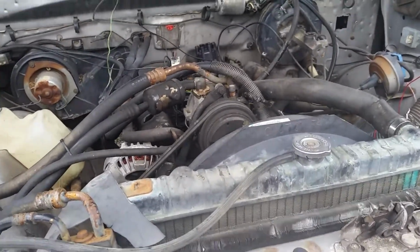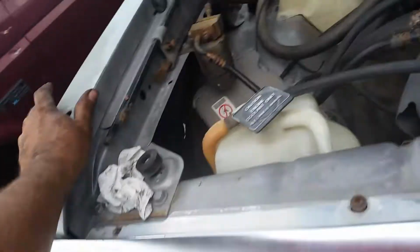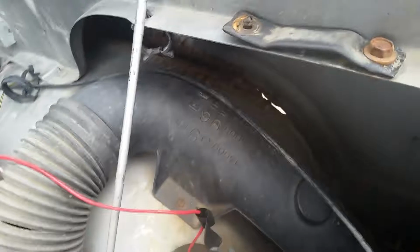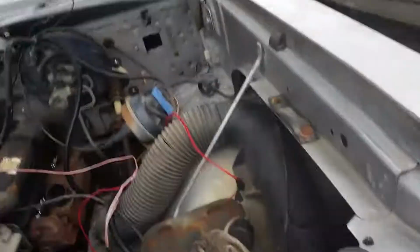This was the fancy truck. It even had tilt and cruise. So that's a cruise control servo there on the fender. This is the one that you wanted to build as a hot rod. I do see some cancer at the inner fender in there. The inner fender, not the fender. The inner fender at the fender, and maybe at the fender lip. Man, I'll tell you what. For a couple years, you could not find these fenders. And a fender like that, 10 years ago, that would have been at least a $100 bill. And this one here, it needs cleaned up inside where that inner fender mounts. But I'll tell you what, if I needed a fender for a Dodge truck, I'd take that off. I'd sand that metal clean, put some sort of rust treatment on there, paint it on the inside, and nobody'd be the wiser unless they look from under the hood.